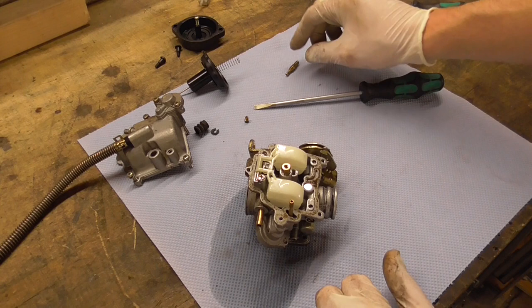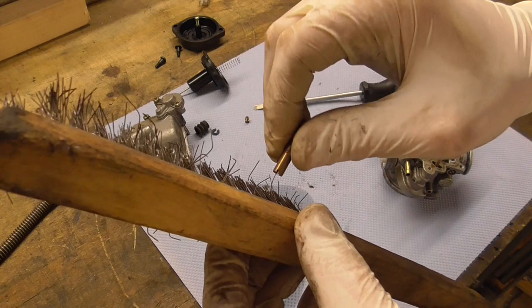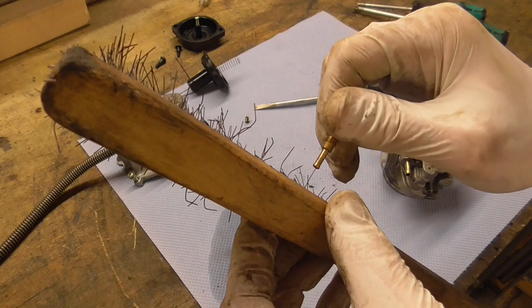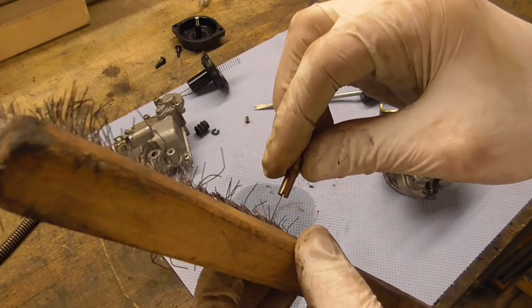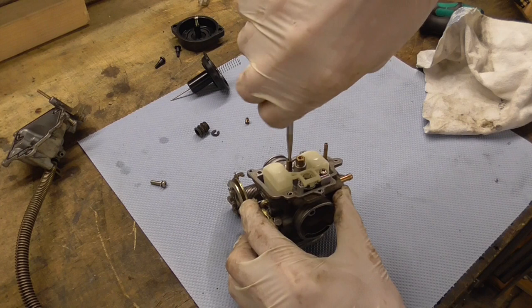I have experience cleaning these jets with a wire brush — the wires are really thin and fit through the tiny holes. When the jet is okay, the wire goes through easily, but right now it's not going through. We work it all the way through from both sides. Cleaning the idle jet should make the scooter run properly again, so we'll put everything back together and see.